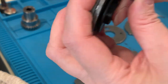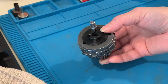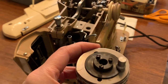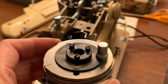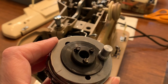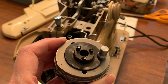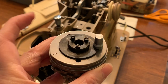The top cap part of the cam stack — this little black piece I'm holding — has a little notch that goes right into that pin, and you'll be able to just stack everything underneath it. I'm about ready to reinstall the stack. I just want to mention that these screws are stripped — they're not down all the way. Find the right screwdriver for the job and don't strip them. These screws are probably proprietary, and good luck finding another piece even a screw that will fit.